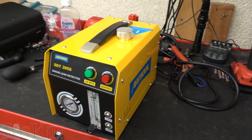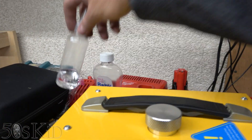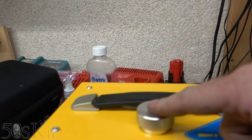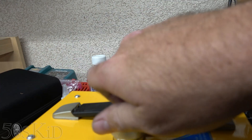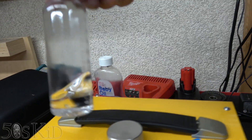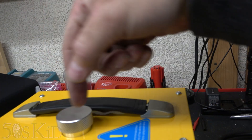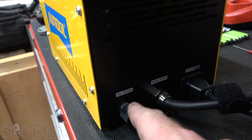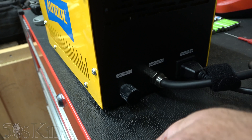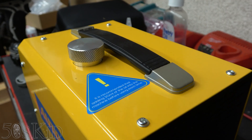But this thing is actually professionally built, so I'm really stoked about this tool. It uses an oil-based fluid — it's not a water-based fogger — so you use mineral oil. I used baby oil in this particular case. You fill it here at the fill port, which has an O-ring on it, which is really great. They give you this applicator bottle with a little pointed tip — super easy to dispense the oil without making a big mess. There's also a drain port on the back, so every time you're done, they want you to drain the oil back into the container. That way you're always adding 20 milliliters of oil whenever you use the tool.